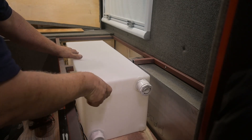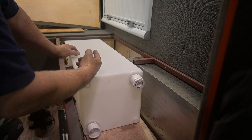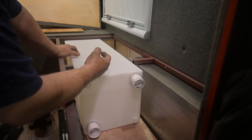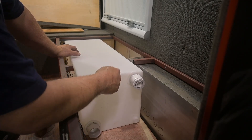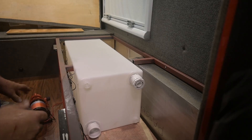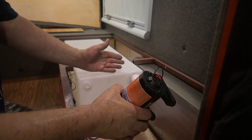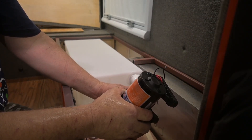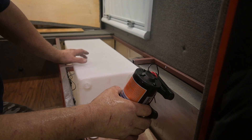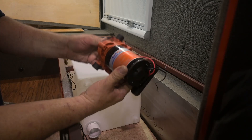The tank is going to go here. I'm going to cut out this brace because it's a little bit too high. I'm going to favor it forward because my tongue weight is pretty low. My trailer weighs 1,580 pounds and my tongue weight is 72 pounds, so we're about 70 pounds low on the front. It still tows alright, but I'd rather it be right. The axle is right about here, so we'll favor it forward to the axle — that'll give us another 166 pounds with 20 gallons of water. Look at this pump from Amazon, it's 50 bucks and has really good reviews.